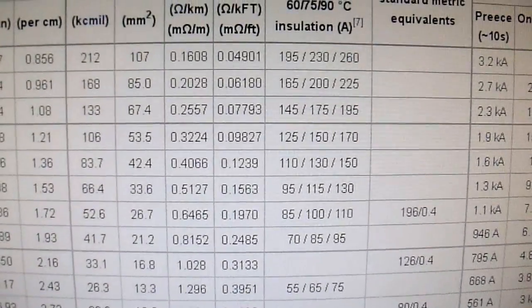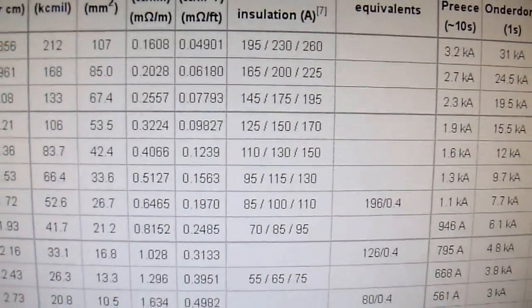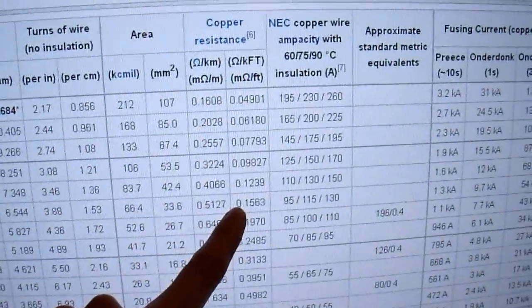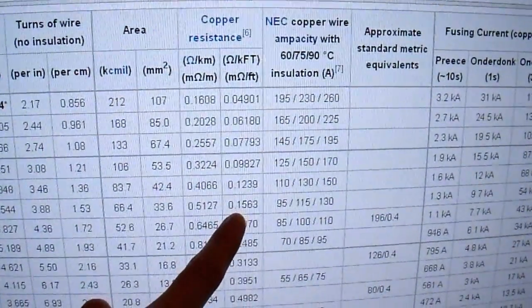It also depends on how you plan on using it. If you know that you're not going to put a 1500 watt load on it indefinitely, then you can probably get by with a thinner wire. But this is how you choose the wire size for thermal reasons, for safety reasons. So we looked at the wire ampacity, and we chose to go with 2 gauge wire. It may be a little bit marginal from a safety standpoint, but it is what the manual recommends, and I'm just using that as an example. So that's the first part of the equation — now we have wire that's safe to use. The second part is voltage drop. We go right back to the table we were just looking at and go to the 2 gauge wire. Over here at copper resistance, we look at the milliohms per foot column, and this is about 0.16 milliohms per foot.